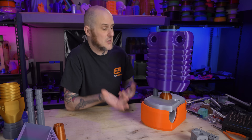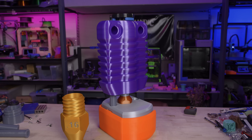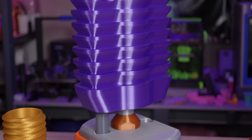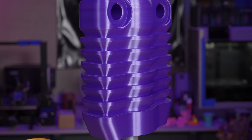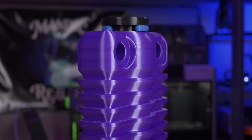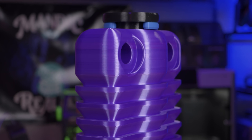And then there's this big beast: the 1000% hot end. Heat sink, heater block, heat break, screws — even a little collet and retainer clip on the top for a Bowden tube. I really had to dial in the silk filament for this — that took some tuning and time. There's maybe a little Z inconsistency up near the top where layer times were varying, but overall the quality I'm really happy with. There are actually two pieces of flexible filament on this, so we should talk about how the Neptune 3 Max handles flexibles.